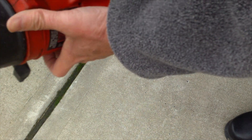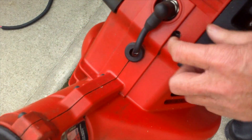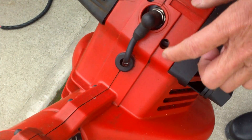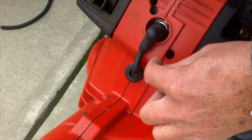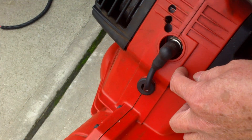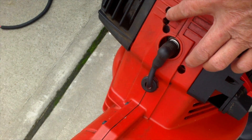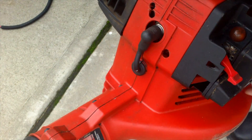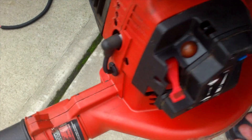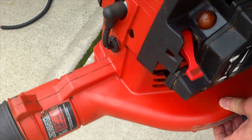It's working great now. Like I said in my other video, I drilled two holes here so I can access the cylinder hold-down screws. If I need to, I can just use a screwdriver or Allen wrench and tighten the crankcase, and it should be good — I don't have to open up the cover.